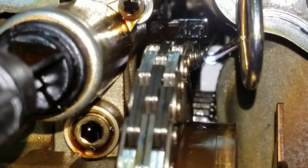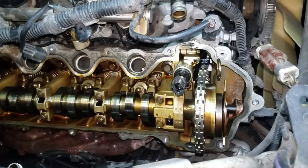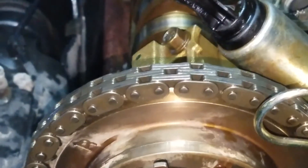Just make sure once you have this sucker in place it's not going to fall out — that's going to mean a lot more work. You can see right there, it's wedged between the two chains and it's holding the tensioners open. I've got another shot with the timing cover actually off to show you exactly what this wedge tool is doing to hold this chain in place. As you can see right here, that's a cable style one and it's just wedged right in there, holding the tensioner, chain, and everything in place. Now that we got that in there, before we start taking anything apart, I'm just going to put a mark on the chain and on the cam phaser to make sure I put this back in the right orientation.